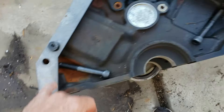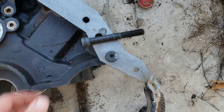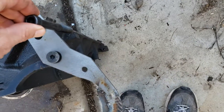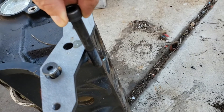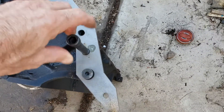The dowel pins you'll have to knock out of your block and you'll just run a half-inch tap, half-inch by 13. So this is what I used — I think it's a 3 inch, maybe 3 and a half inch. The idea is when all this threads through, you're going to end up with about that much of it going into the block. And that's what aligns the transmission to the motor through the original dowel pin location.